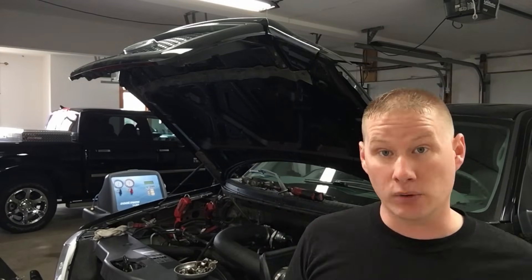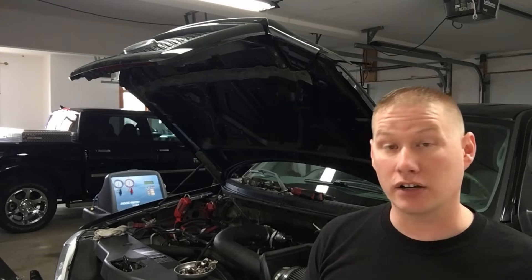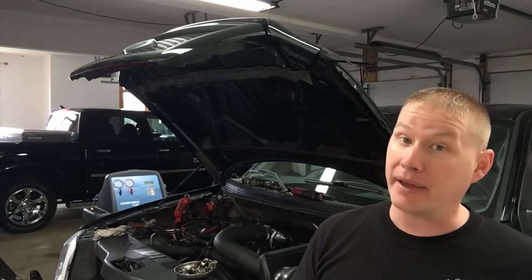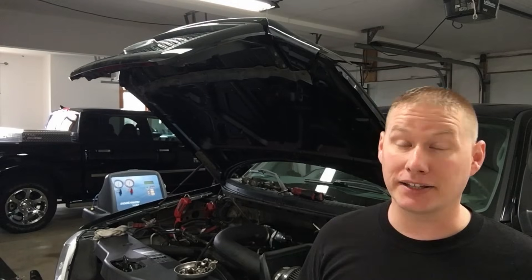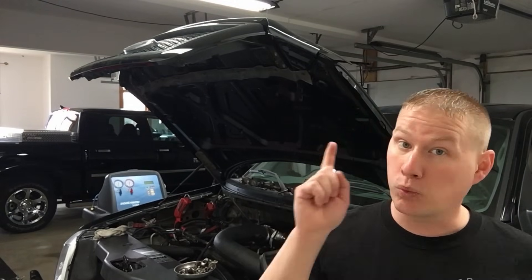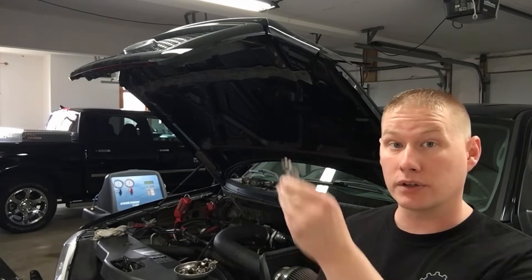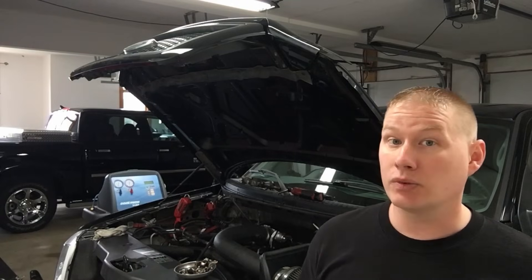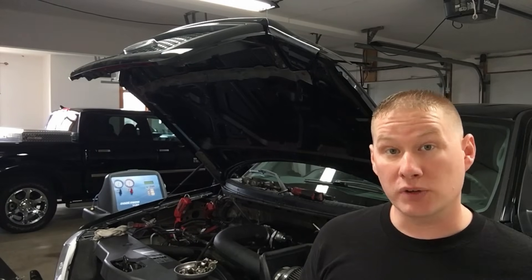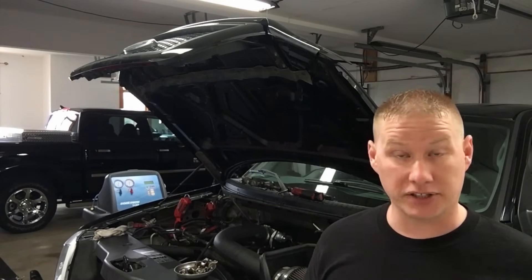There are a lot of different failures associated with the 5.4 liter 3-valve engine. Unfortunately, from 2004 to 2014, basically the same parts were used. I have a whole playlist on my channel dedicated to this engine, but one subject I haven't covered yet is failed lash adjusters and roller followers. In the early dealership days, as these went out of warranty, we didn't see the early 04 and 05 models — but when the engine was first introduced, this failure was rampant.